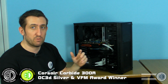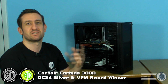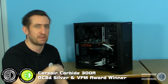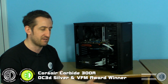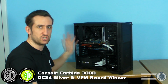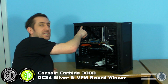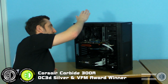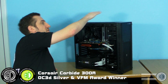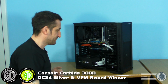And let's face it, why would you put, for argument's sake, a £90 cooler in a £60 case? You really should have your budget being spent the other way around, spending £90 on a case and £60 on a cooler. I know I've got the H80 in here, but it's just to show you that it can be done. But if you do use the H80, it's quite critical that you then cannot mount any fans in the back portion of the case. You can only use the front options in the roof mesh.